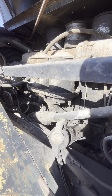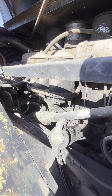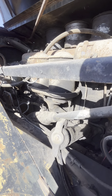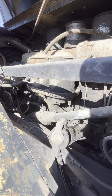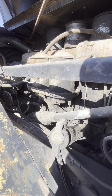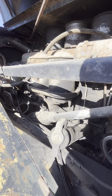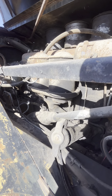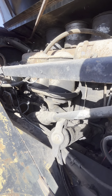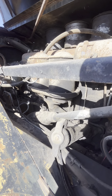The drive shaft brake is missing. There's a disc, like a disc brake, that goes in between these two flanges. You've got brake shoes on both sides — disc pads that squeeze on there. It goes to your parking brake — that was an actual disc. They made different versions for different models. These are the caliper mount pins. Two pads on each side and the disc in between these two flanges. Somebody just took it out, pulled the flanges together, took the shoes off. This is part of the actuating mechanism — these rods are hanging down. When you pull back on that lever, it pulls these two rods up and that's what closes the pads on the disc.